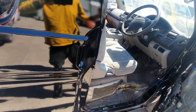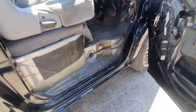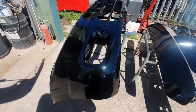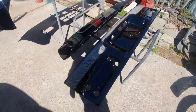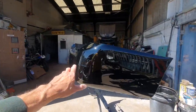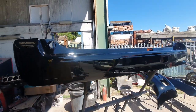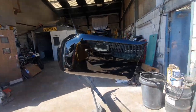The plan now is to mop this back on the driveway. That's all the front done and sparkly. All the welding underneath has been done, all the rust and rot has been cut out and sorted out, it's all been painted properly. Let's open the door. All painted in the door jams - remember all the rust that was running down here, that's all been done. All the steps are done and blown in. It has had an absolute proper job. Look how sparkly that bumper looks. It is looking mint. There's a little run mark there, it needs to be cut back. This is the only major problem - this was covered in some horrible paint and it is cracking and spidering, so I need to get a new bumper. This one will be thrown away.